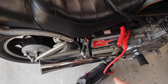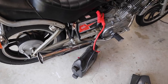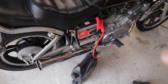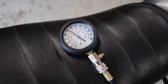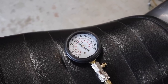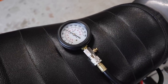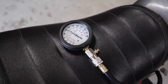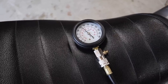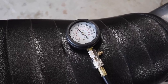I've got the jump pack connected — it's not fully charged, so I can hear it beeping because it needs a charge. I've done one test on this side and two on the other side, and they're pretty much equal. I'd say maybe 135 psi in each cylinder — that's kind of where it's at. I'd also like to do a second test dropping a little bit of oil in the top of the cylinder to see if I get an even higher reading. I haven't checked the specs yet. Let me know in the comments if you know a lot about these.